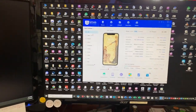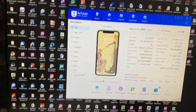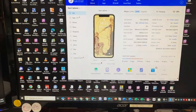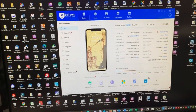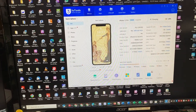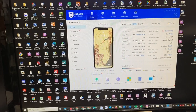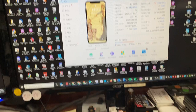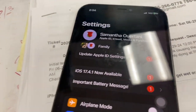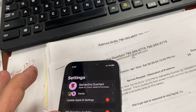Let me show you what I got going on today. Here I have on my screen an iPhone 12 Pro. We changed the battery. So what I want to show you is if you change the battery, unless you change the serial number — there's a chip on there that's programmed to the phone — you're going to get a message. So if you do this aftermarket, pretty much you're going to get that important battery message right there.